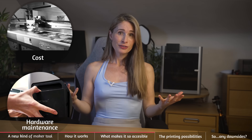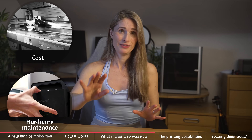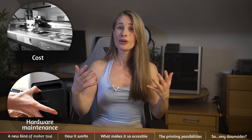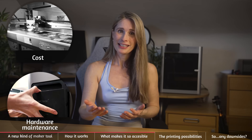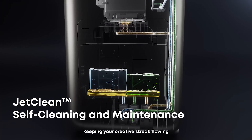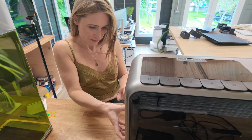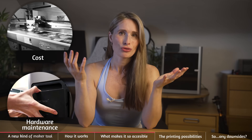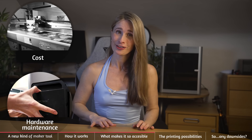Hardware maintenance is key. Professional grade printers are finicky and need careful maintenance to keep them running. Like lots of similar devices such as DTF printers, they don't deal with not being used very well — you can often come back to a device and need to unclog all the parts that have dried. EufyMake have seemingly smashed this problem. It has a smart cleaning and maintenance cycle that does it all for you, keeps the print head automatically moistened, and uses a cleaning cartridge to cycle and clean itself. This comes at a cost of about one to one and a half millilitres of ink per day — a trade-off well worth it for the time saved. Home users do not want to spend their weekends fixing clogged devices.